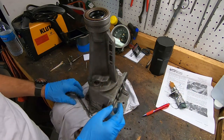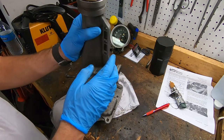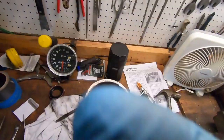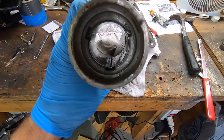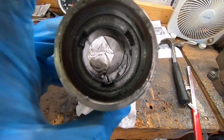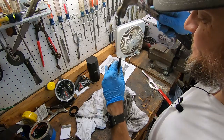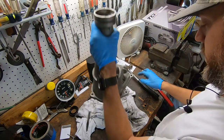As you can see at the very bottom, there are some grooves in it. We're hoping to get something in there and pop it down. You can see where I've drilled a groove in it and did not get into the edge, which is good. We've got it almost cut through, and hopefully the chisel will break the tension so we can slide it out. There it goes — she's out. That was enough of a cut to just barely release the tension without damaging anything inside. We need to make sure we get all the metal shavings out, because every bit you don't get out will go through your transmission.